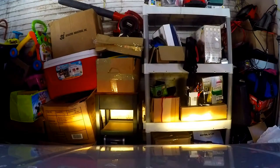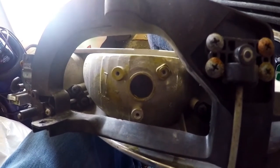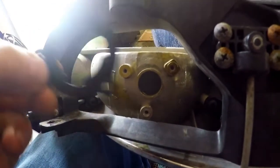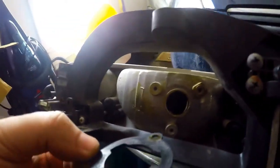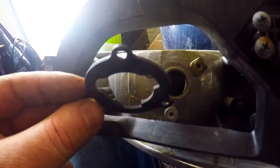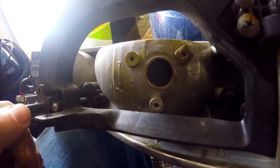There is one modification I've had to do on my headlamp unit. These are not factory — they are OEM replacement. However, there were three screws I had to take out to modify the little plate where the 9006 goes in. There were three little tabs that stuck up that were getting in the way of the heat sink on the bulb, so I just got some sandpaper, put it on the ground, and sanded them off. They worked just fine.